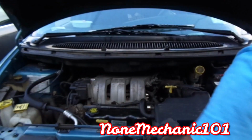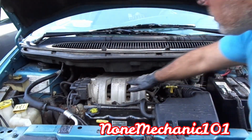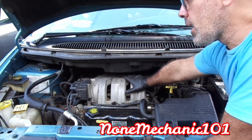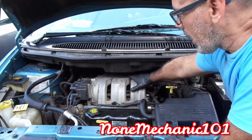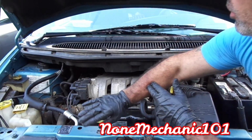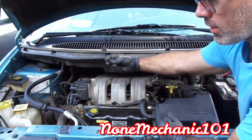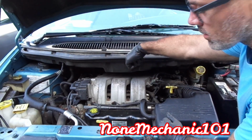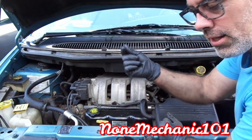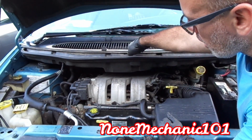As you can see, most of the problem was number 3, the middle one. So you're going to have to get a socket with a magnet just to get it out, but with patience and everything you can do it. Me, I was having a hard time because my hand couldn't fit in there, and you can see how red it is. So I had to play everything by feel. Then I started using the mirror, and the mirror worked perfectly because now I can see. So that's what I learned from this. Use a socket with a magnet and also a mirror.